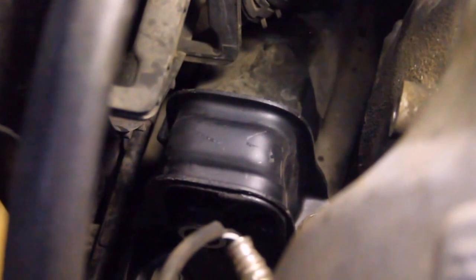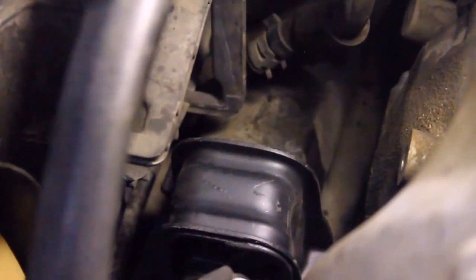They're a little bit cheaper, maybe half the price. This one was in the $50 range from the Honda dealership, and they're 20 plus from a local parts store. But the problem I had with the aftermarket motor mounts, and I tried them twice, is that the holes for the bolts didn't line up very well, and it's an awkward place to try and pry it about to make the holes line up for the bolts. And so it was worth it to me to buy the perfect fit from the dealership and not have to fight those awkward or misaligned bolt holes.